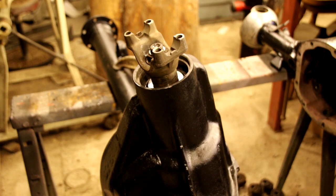We're going to take it apart and we're going to finish up the pinion installation. We're going to put the oil slinger in there, put the regular yoke on, put the oil seal, gasket, stuff like that, and we're going to finish up getting that pinion in there. And like I say, I made 4 adjustments. I started out at 55 thousandths shim pack, and I wound up at 81 thousandths to get the rotational torque right. It squeezed it where I couldn't turn it with the 55 in there.